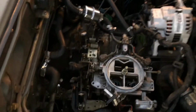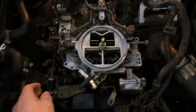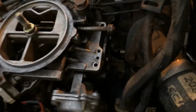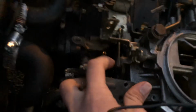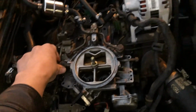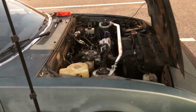Okay, we're starting it up now after we just put it all back together for the first time. It was the stuff pulling it. Yeah, all this extra choke stuff was pulling it down a little bit. But y'all can't see the bowls, it's a little too dark. But now here's the second time you'll check each of these bowls to see how the fuel level is. So, wait, don't turn it back on. I shut it back off.